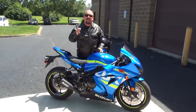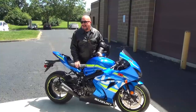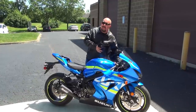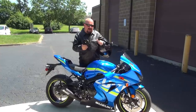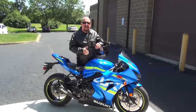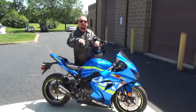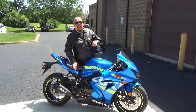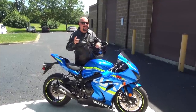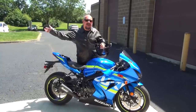I'm going to show you how a back torque limiting slipper clutch, even though it's a great thing to have in a motorcycle like this, really doesn't work out for motorcycle drag racing. If you're going to launch your bike from a dead stop, you just can't actuate the clutch smoothly. As soon as the bike starts to move, it instantly ramps and locks up the clutch, and you spend the rest of your time either wheelieing or ratcheting back and forth as you try to control the clutch. We don't even need to go fast or break the speed limit out there.